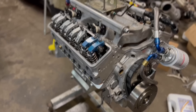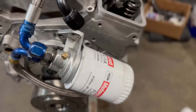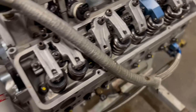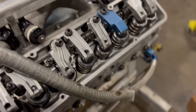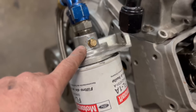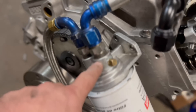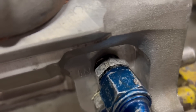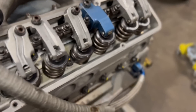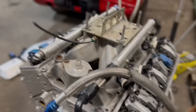We're almost to the stopping point - this is where I wanted to get tonight. Got the oil filter on it. I had to put a plug here because I couldn't find my number six cap that goes to the turbo. Just put six quarts of Rotella in this thing. Rocker arms are adjusted, intakes on, oil pan on, six quarts oil in it - and it is not pouring oil everywhere. The filtered oil comes up through here into the turbo, and the bottom port is the oil out from the pump.